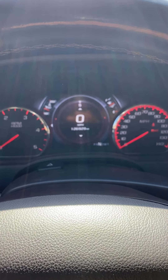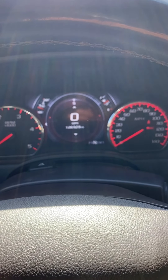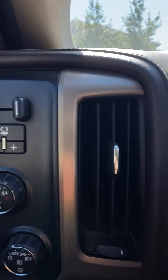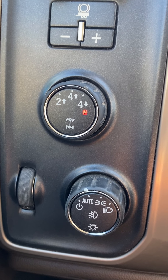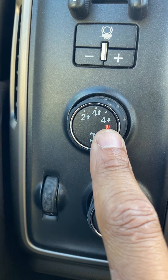You're going to turn your dial all the way over and hold it. There is a mechanical wizardry going on by the vehicle — that's the transmission and the transfer case going into neutral. As you can see, it's illuminated here. The transfer case is now in neutral because the N for neutral is illuminated red.